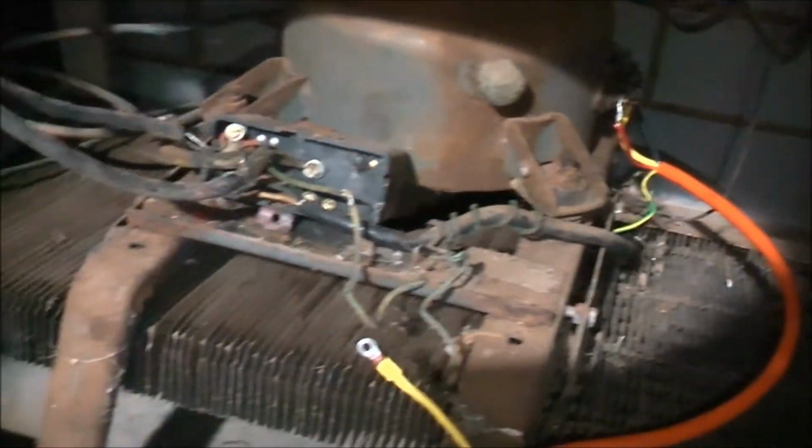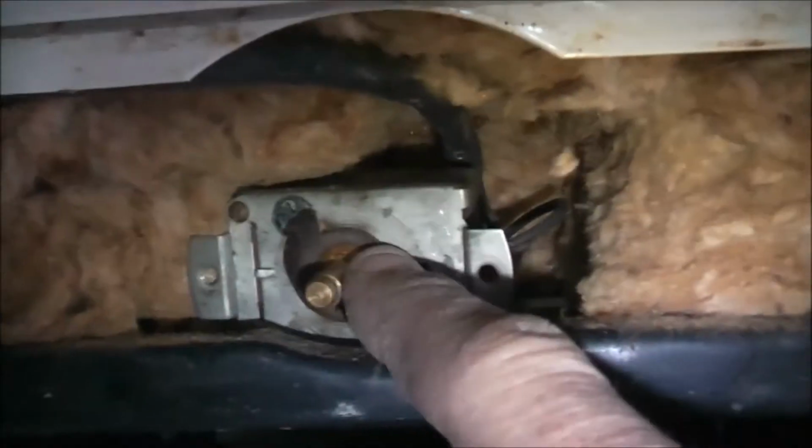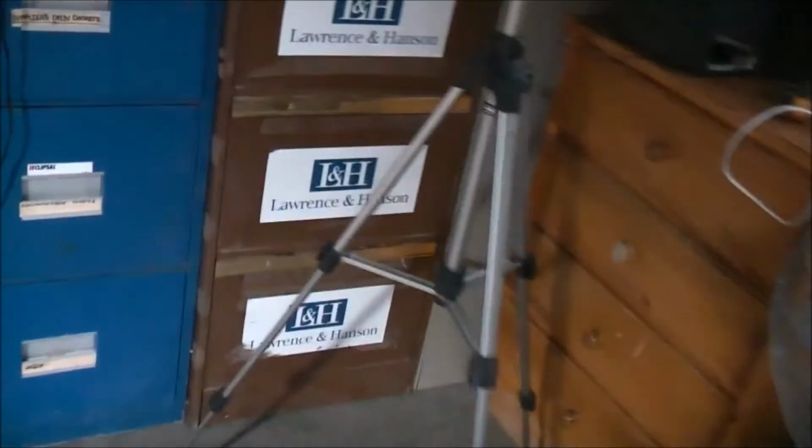Anyway, let's get into it and get this thing wired up, and I will start on some new wiring. I don't even need that thick. I could just use ordinary modern 2-core flex. It doesn't have to be that thick, although I probably should, because the earthing for this doesn't have an earth for it. It just earths to the cabinet via the screws.